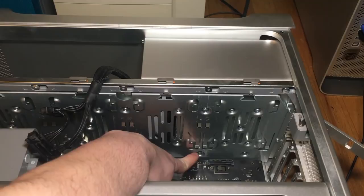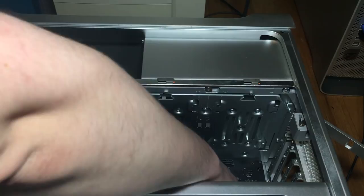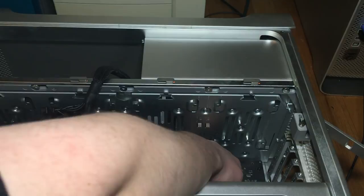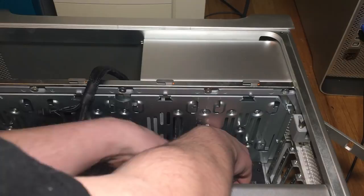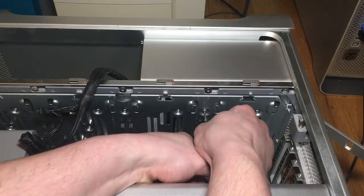Underneath the power supply are four screws holding it in. I'll be tilting it sideways to show you where those screws are. You want to remove these four hex screws — they appear to be 2mm hex. Jay recommends using an extension for this. Factory torque is a pain — an extension would definitely be handy. I'm going to try to figure out how to get that to work.